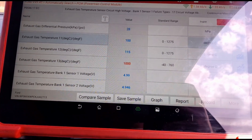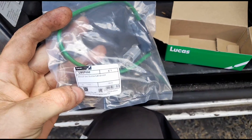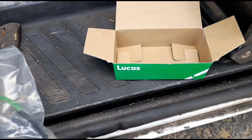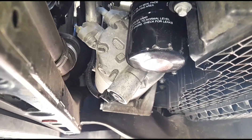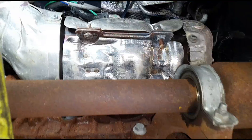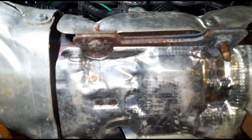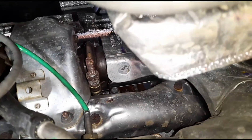We don't seem to get much movement from the exhaust gas temperature sensors. I've got a sensor from Lucas to fit into the vehicle. Making our way under the vehicle — you can see the oil filter has been changed for a nice new one. Coming around the back, we've taken off the tray and we can now see the DPF just here. I'm going to try and get the camera up so we can see the exhaust gas temperature sensor.